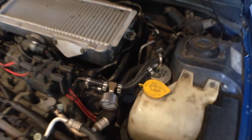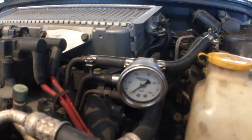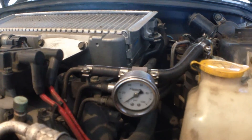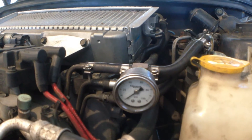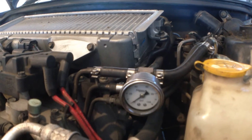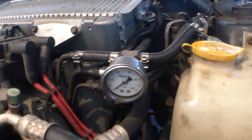It's better if you do this job when there's no pressure in the rail — first thing in the morning after it's been driven. As you can see by our inline gauge, it's got zero PSI, so we've got no residual pressure in the rail. There will be fuel in it, but it's not going to squirt at us everywhere when we pull it apart. If you don't have a gauge, you can trust it first thing in the morning after you've driven the car the day before. If you want to put an inline gauge in, check out our other video. So we've got no residual pressure — we're okay to start.